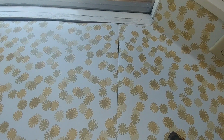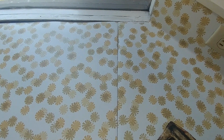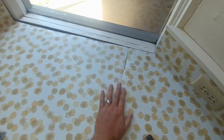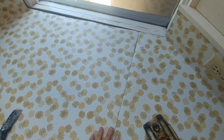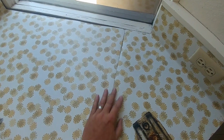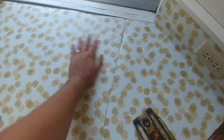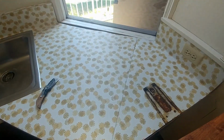Once we do that, then we're going to sand it out. We're going to level it. We're going to block it, make it as level as possible, and then we're going to use our other filler primer, which is our tub primer. It's white. So it goes over the top of that and fills any little air bubbles or pinholes. It makes it nice and level. Now, depending on how bad this is, we're really going to work this to try to make it as level as we can. But we'll get started and we'll show you what we're doing.